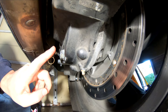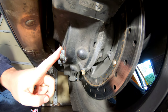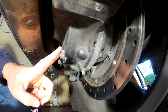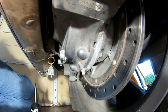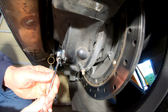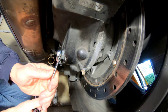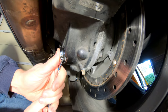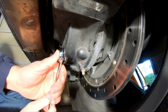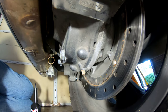What they say is torque this to 15 foot-pounds — that's in my manual, which is a 2012. It's probably the same thing for this 2013 F6B, but you might want to check that with your manual and see what it should be. I know roughly what 15 foot-pounds is. Perfect at 15 foot-pounds.